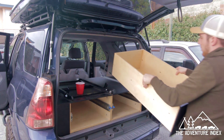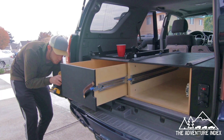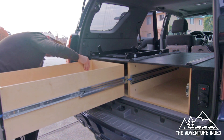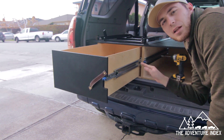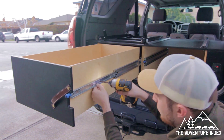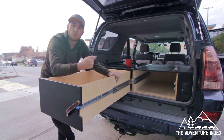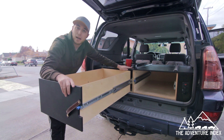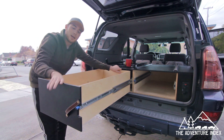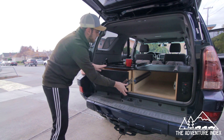Let's go ahead and mount the drawers up. I've found it's a lot easier to do the first and then the third screw — it keeps things in alignment more easily. Now that the drawer is mounted to the drawer slides, make sure it locks in place. If it doesn't, it may be because the drawer is secured too far forward on the slides, causing it to run into the face of the carcass and preventing locking. If that happens, back out these screws slightly and pull hard forward, then tighten them down and it should lock perfectly into place.